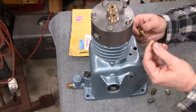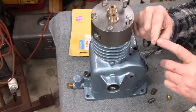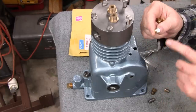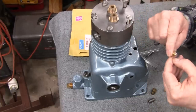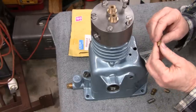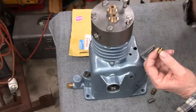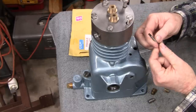But even with this, when you buy these plugs, they're actually hollow on the inside. I know somebody's going to tell me you can get them with solid ones, but I go with what is at the Lowe's and the Home Depot. So what I did is I filled this one here with solder, and that should be plenty strong to hold a thread, especially for this. So we're going to go over to the little baby mill, or the baby lathe, and I'm going to cut this off and drill for a 3/16-40.